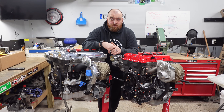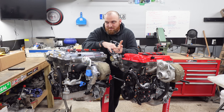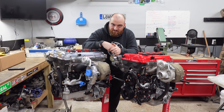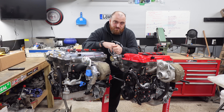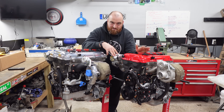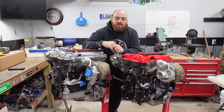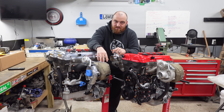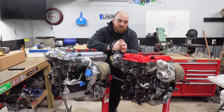You can't make a bad decision with either one — both are fantastic. Through my weird rating system, both of them rated the same. But if you want my personal opinion, I think the Kraken manifold looks a little better and I love the three-inch V-band downpipe and exhaust options, so Kraken gets my vote. I also like that I can put a G25-550 on it. The Flying Miata is 99.99% as good and will do everything you'd want at that 300 horsepower power level.